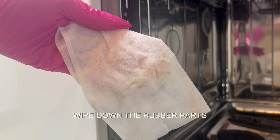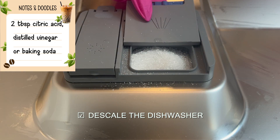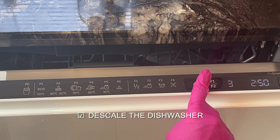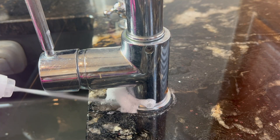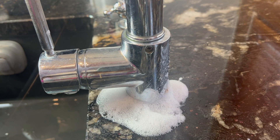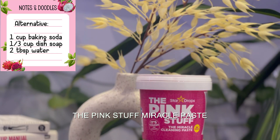Don't forget to wipe down the sides of your dishwasher, as those are the ones that oftentimes get splashed with grease or leftover particles. To descale the dishwasher I poured two tablespoons of citric acid in the detergent compartment and ran it empty on a high cycle. Then I started working on the sink and faucet area.